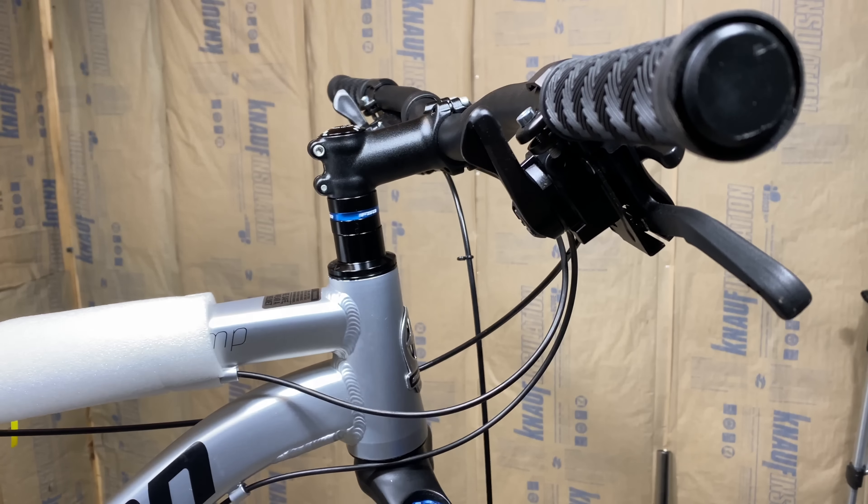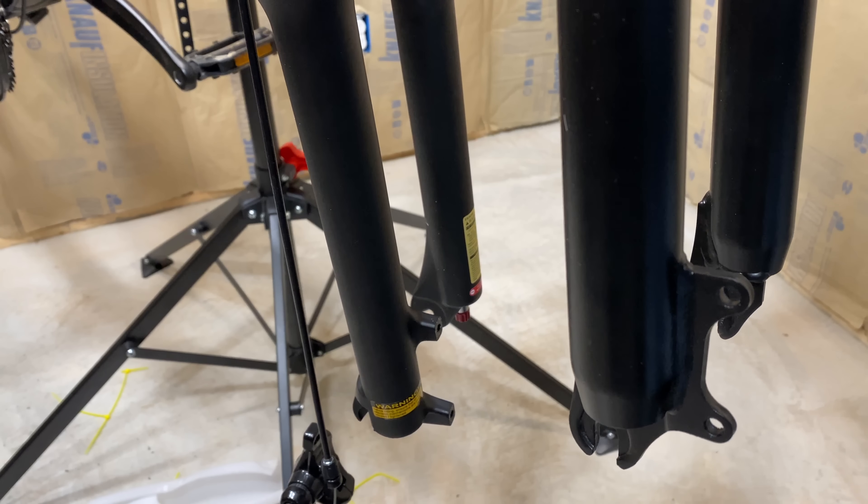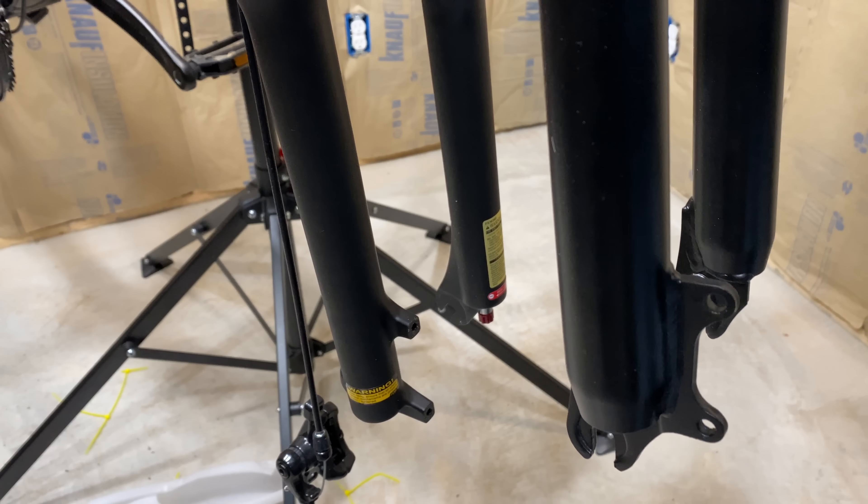Super easy, but I'm not quite done. I need to get the brake caliper installed and make sure it's cable-secured to the fork. Then I need to make a decision: some people are inside cable routers and some outside. I'm going to succumb to peer pressure and go inside. Looking at the old fork, the bolt openings are sideways compared to those on the new fork — that's because it used an adapter. But we don't need that for the new fork, because the caliper will bolt directly on.